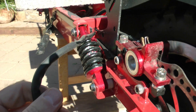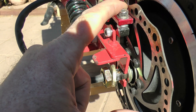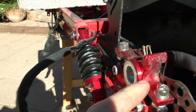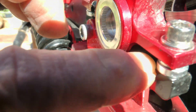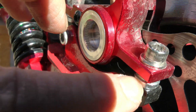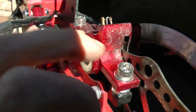Next point: when putting the wheel back on you're going to have to line it into the slot between the brake pads, which is a very narrow space. So that doesn't give you a lot of movement — you have to be very precise, so that could make it harder. One thing I found: if you don't mind taking an extra step, remove the caliper. Take these two screws out, keep an eye on your hardware — there are two spacers underneath those screws. Take those screws out, keep an eye on your hardware, remove the caliper off altogether, and then it's going to make putting the wheel back on so much easier. I'll do that right now — I'm going to remove the caliper.